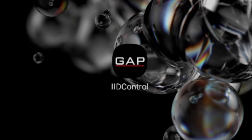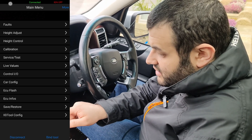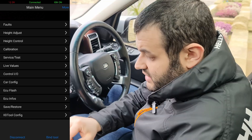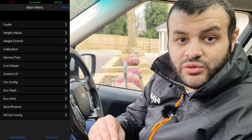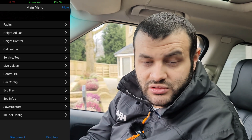We can access the OBD tool through an app on your phone, which makes it really good if you're stranded somewhere — you only need your phone and the app, without internet, to enter the computer of your vehicle and fix the problem yourself. Inside the app you can connect to the last tool and enter the main menu. Turn on the ignition (not the car, just the ignition) and it will show ignition on and the voltage — 12 volts. Click on fault and it will show you what faults your vehicle currently has. You can simply reset the fault or reset the code.